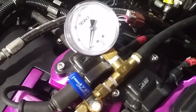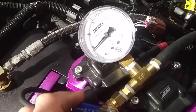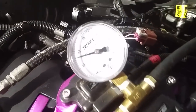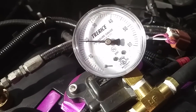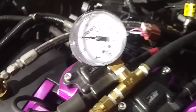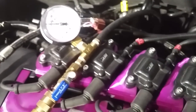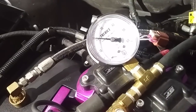I'm going to show you how to boost leak test it right now. Let's turn the valve on and put some pressure on the charge system - I can charge it nice and slow. You'll notice that when it starts to pressurize, that cap starts to pop up, and that's why I told you to make sure it's tight so it doesn't pop off. I'll give it all the pressure that I've got - my tank is set to about 22 PSI and it's going to get there nice and slow. Right now it's probably pressurizing the crankcase. Keeping constant air pressure supplied will allow you to hear any hissing instead of having it go away and having to refill it all the time, like some other boost leak testers do with a Schrader valve connector. This method lets you keep constant pressure, look for your boost leak, listen for the hissing, and see where your boost leak is.